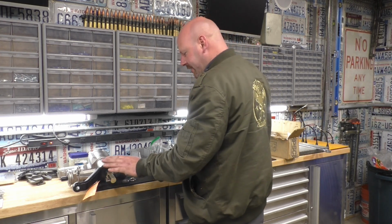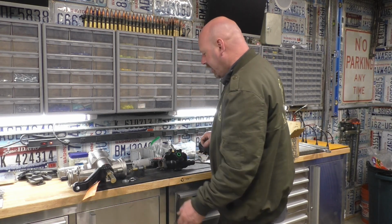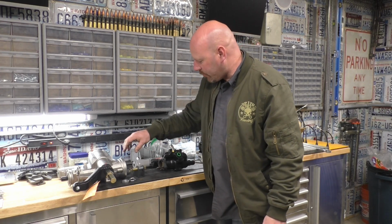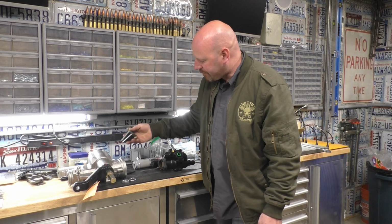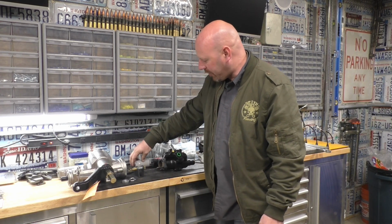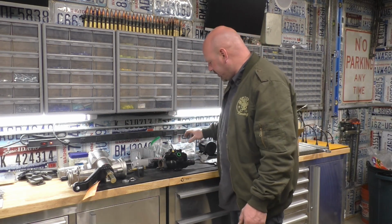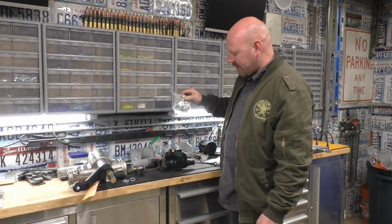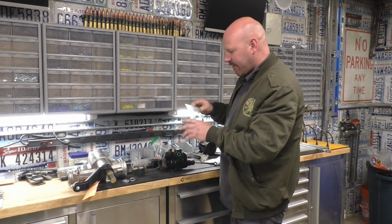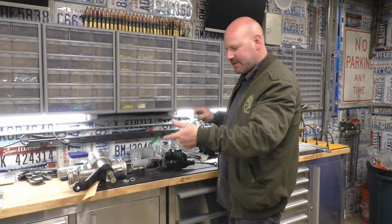So this week we'll put the box on. We'll get our arm on. We got to drill it for that 1-ton joint yet. We're going to mount our cylinder this week, and so we'll weld these brackets on the axle. It actually goes on the truss, and that'll hold the cylinder side. And then on the piston side, I'm going to use this clamp. The reason we're using a clamp instead of welding ears onto that 1.5 inch DOM tubing is so that we can actually adjust it and not be limited to doing full turns of adjustment.